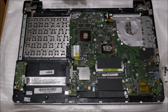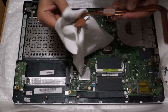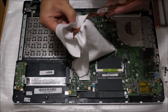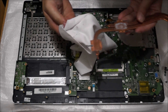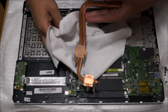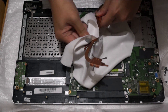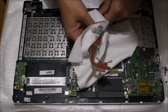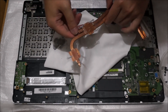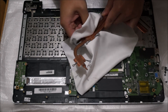You just want to get a cloth. Remember, when you remove your heatsink from your graphics card or your fan, you must replace the thermal paste. You don't need any special alcohol solution or liquids to clean it — just wipe it off with a cloth or tissue, but be careful as tissue generally breaks apart. Also, when you clean off your thermal paste, make sure none of it falls onto your motherboard.